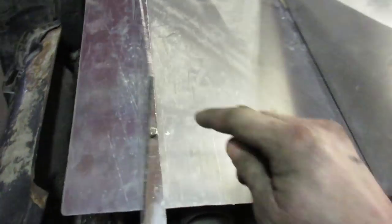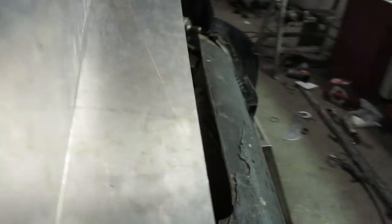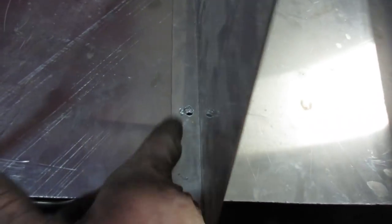For the diffuser I've got speed nuts that end up in the runner underneath there that will bolt it down, but I'm still going to PL it and rivet it because this one doesn't have a runner underneath it — the fuel tank is in the way. I'll drill holes for the rivets now, which makes a hole in the runner, then I can drill that hole bigger so the end of the rivet can go through and I can still take the diffuser off. I have a diffuser — never thought I'd have a car with a diffuser.